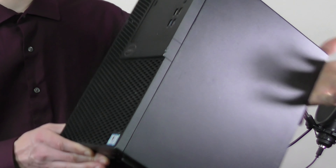So I had to pivot, and that's why I'm not going to be messing with either of those two computers. Instead, I have this — an old Dell Optiplex 3050. It's from around that same era, holds up to a 7th gen i-series processor, and also has M2 boot. It won't be as interesting or as crazy as the intended video, but we're still going to get a little crazy with it. I'm going to add the new processor, set it up for M2 boot, add a decent GPU, and even try to do a power supply swap. If it actually pans out, we could have a decent computer, but it all hinges on having a power supply that can run a better GPU.